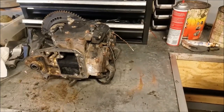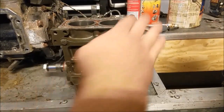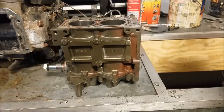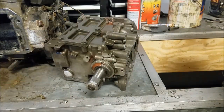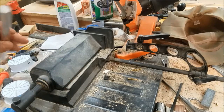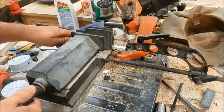Most of the time you can just use a drill press. Like on this powerhead — it has a flat surface on the back that's parallel to the top, so if you're trying to drill out the cylinder head bolts, it's a piece of cake. The problem comes when you're trying to do anything on the bottom because you can't put it upside down — you don't have any flat surfaces — so you need to use a hand drill, and good luck keeping that straight. I have a little piece of hex aluminum I'm going to use. I would have preferred steel, but I don't have any and I don't know if this experiment's going to work anyway, so I'm just going to use the aluminum.